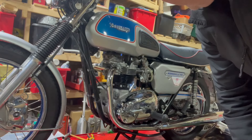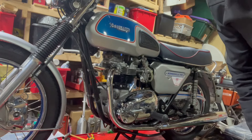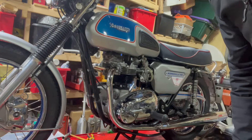So I'm going to try and repeat that now with the camera on. I'm just going to tickle it, no choke, ignition on, and then we'll give it a go. It only ran for about five seconds or so, but it did run and the motor was very quiet actually, so that's good. Remember I've already primed the oil — when I kick it over the oil light is going out, so we've got plenty of oil pressure, which is great.